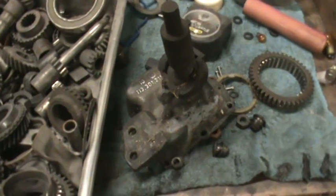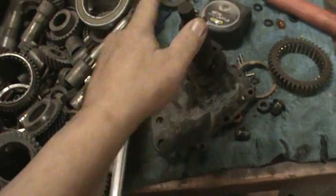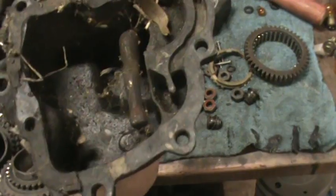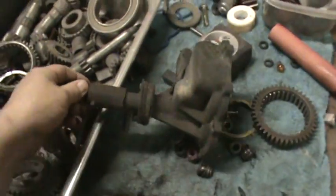You can buy the correct nose cone from Airco out in California. The hockey stick alone is $200 - that's for the selector stick - because it's a special stick. The position and the way it grabs the selector shafts in the transmission is different on a bus.